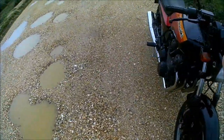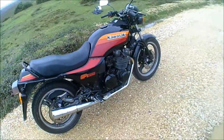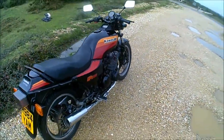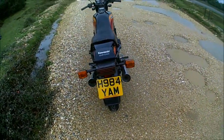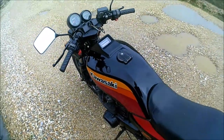I do keep it well lubed up. We use gear oil, EP80, on them. I tend to clean the chain every 50-100 miles. I know it's a little bit anal, but I do get some, quite frankly, ridiculous mileage out of chain and sprockets. I've had over 40,000 out of them before now.